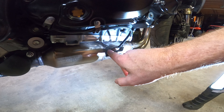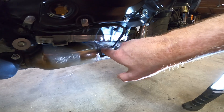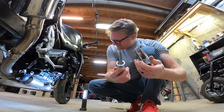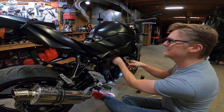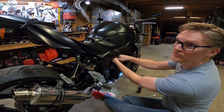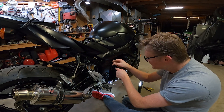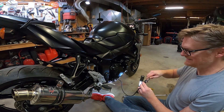So we got that opened up, but now I need to install the wideband O2 sensor and remove the stock one — it's right here. They make specific O2 sockets for these. I don't think I have one that small, so maybe we'll just get a wrench on it. I do have giant O2 sensor sockets but they're too large. If you already have a power commander installed, then you have an O2 sim running. The 19mm fits over it but the 17 does not — well, just barely, maybe.